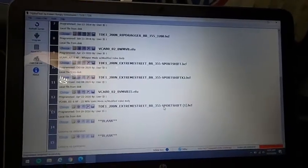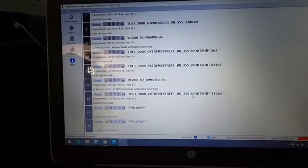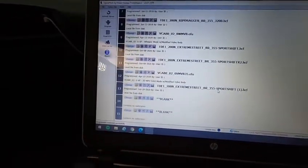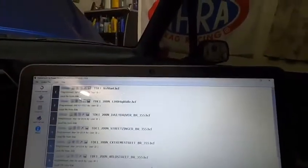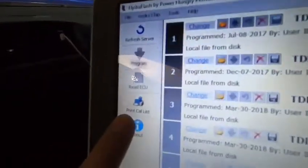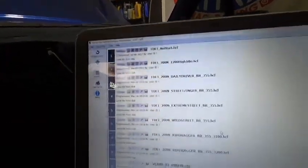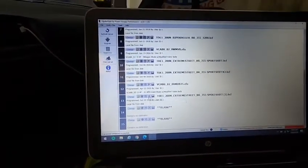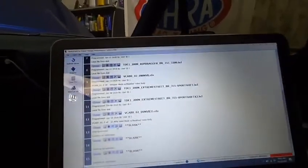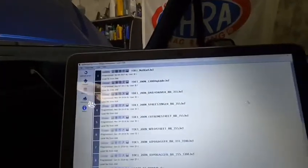At that point you're ready to go. Go ahead and unplug your computer and turn the truck on to the new tune file to make sure everything is good — make sure the file isn't corrupt for any reason. If you'd like to print any of this out, Hydra has a calibration print list option. With a printer, wireless or connected, you can press 'Print Calibration List' and it will print out each position and what's in there. This is something you can change anytime you want — if you need to delete a tune, just press the X while the truck is plugged in and it will delete that tune from the chip.